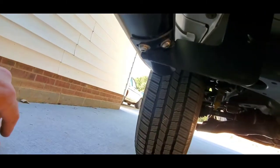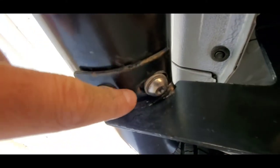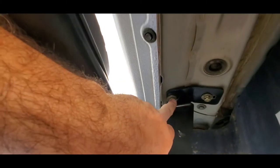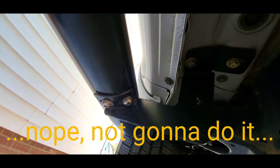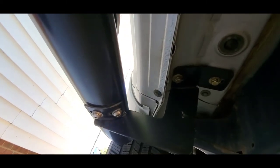While making adjustments, I wanted to make sure the step itself wasn't tilted out — I wanted it as flat as possible, because if it tilts down it removes clearance. I could see where the previous owner had the bolts in a different location. I went ahead and took all six Allen-head bolts out and applied blue thread locker before reinstalling them.